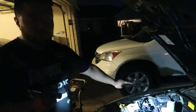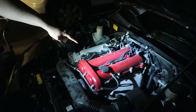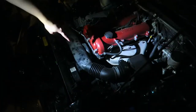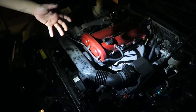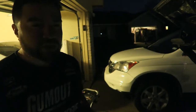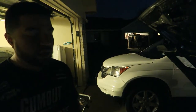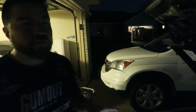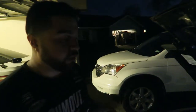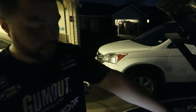We're going to remove the radiator, take out the overflow tank and wash it out because it's contaminated with the old stuff. We'll also take off the heater core lines and pressure wash the heater core, and take off the thermostat and clean up the thermostat housing. Coolant lasts for five years or around 50,000 to 100,000 miles. Since we don't know the history on this car, we're doing it now to prevent anything in the future.